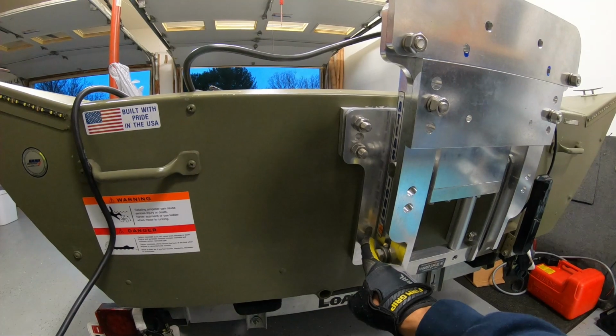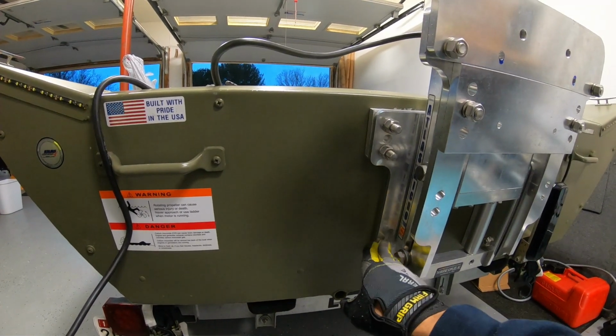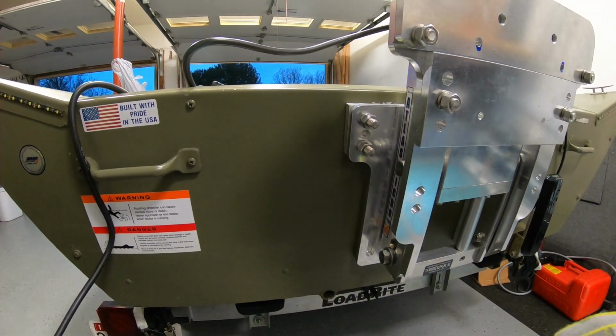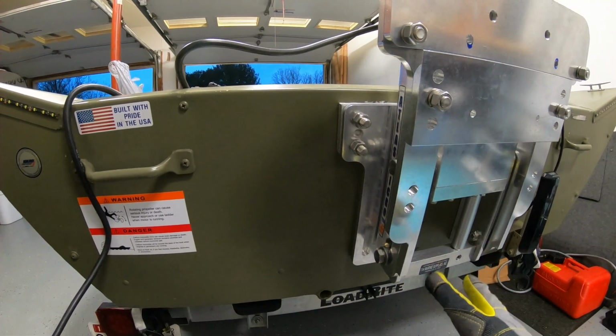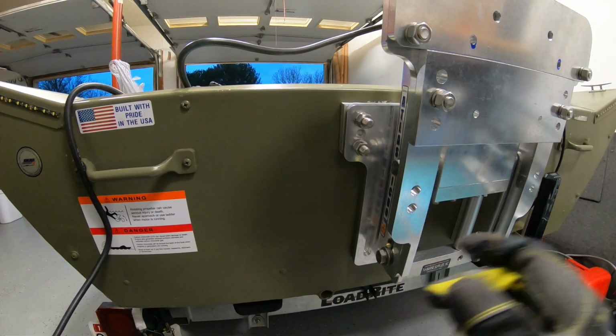One is to drill through the transom, and this is the part I am dreading the most because this will be below the water level. We're gonna fill up these holes big time with 5200. Don't want any leaking. This is actually my first time drilling into my boat below the water line. Wish there was another way, but it's the only way. Guys, keep your fingers crossed. We're going in.